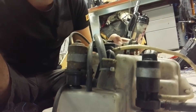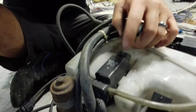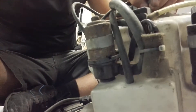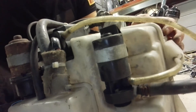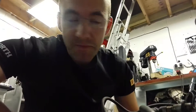That's shown as headlight washers, funnily enough — so that's for the FIA. I then went and had a look at the actual tank itself and it's got basically motors and valves all over it. What you've effectively got is: this is the windscreen washer pump — that's pretty normal — that is a pump for the water injection, and that is a pump for the water spray bar on the front of the charge cooler radiator.